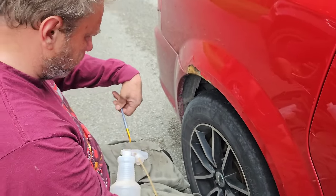Putting this on here will neutralize it for a little while — it'll probably last a couple months in summer weather, even in rain, before it starts rusting again. If you're trying to preserve your vehicle you could put this on regularly to keep it from rotting more and ending up with holes. This piece is in pretty bad condition, so I would recommend replacing the metal in this section rather than doing what I'm doing here. This is just my friend's van and I thought I would do it to demonstrate what the results are.